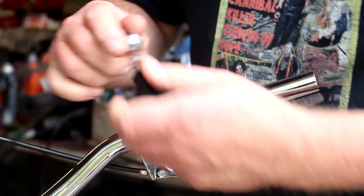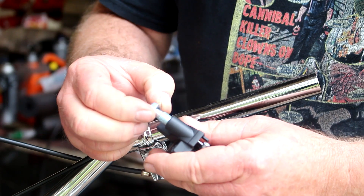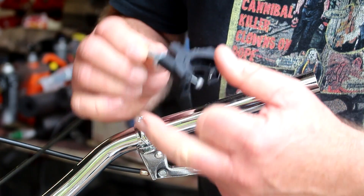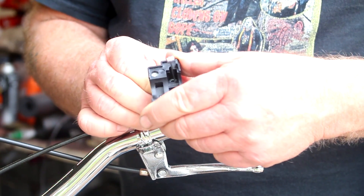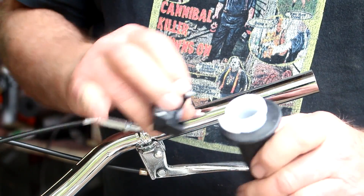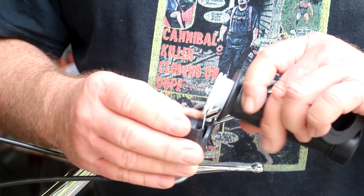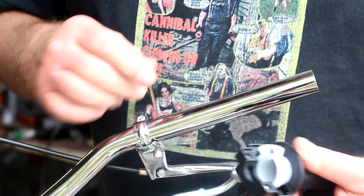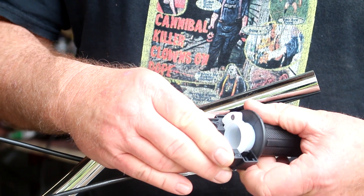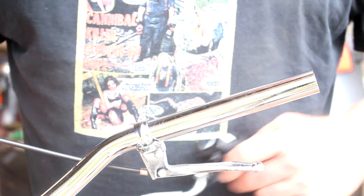To show you the right way, we're going to put the cable in — you can see it's through here. You have the locking nut here; I'll screw that on just enough so the nut is on the threaded part. Get the alignment right. You have the hole here and the cable end goes into the hole. You have a slot in the grip — that is for the cable to be guided into, and there is the correct way. I've got a little bit of gap here and ultimately we'll tighten up our fittings to get rid of that gap so when it's bottomed out you don't have any play in the cable.